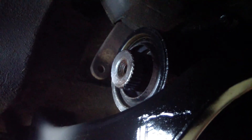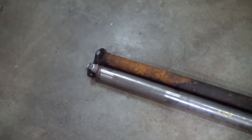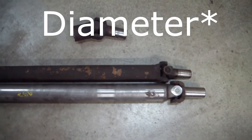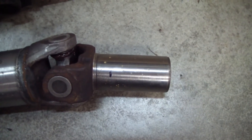The trans is a little shorter so we had a new drive shaft made. The measurement the drive shaft shop took was from the end of the output shaft to the bolt hole on the pinion yoke — this face right here. Here is the new drive shaft; you can see it's a little bit longer. They actually used thicker tubing and thicker wall than what was on the Turbo 400 drive shaft. With the weights on it you can see that it's balanced. They sized it so the output shaft ends right here with about three-quarters of an inch play between that and the slip yoke — that clearance is for when the suspension gets compressed.